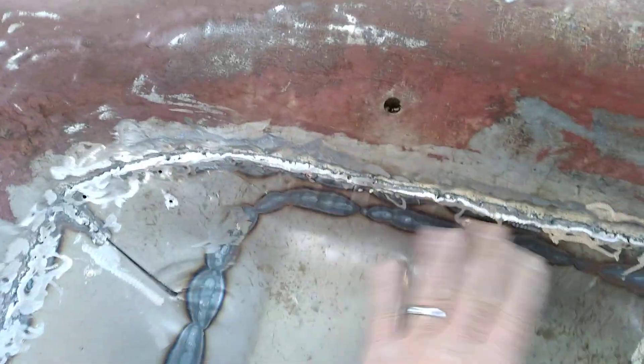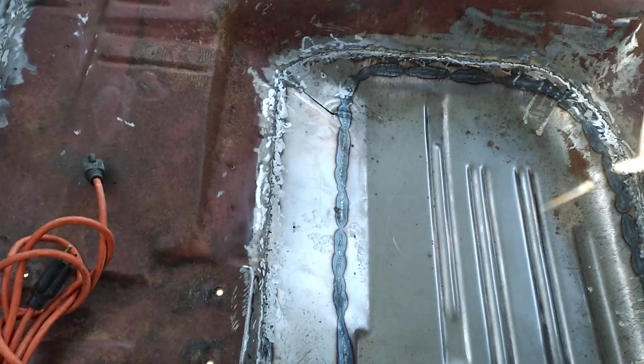So you're going to weld them across here. I was already grinding my welds down — we call it knocking it down. I'm going to knock them down one more time. Then what you're going to do is put sealer in between — a primer or sealer.